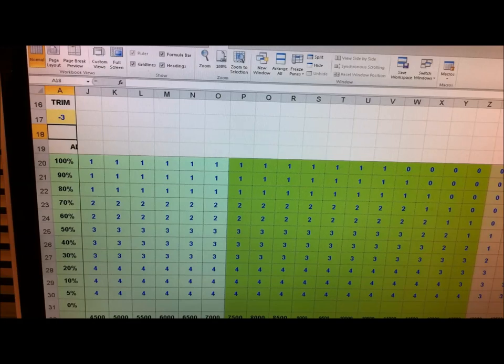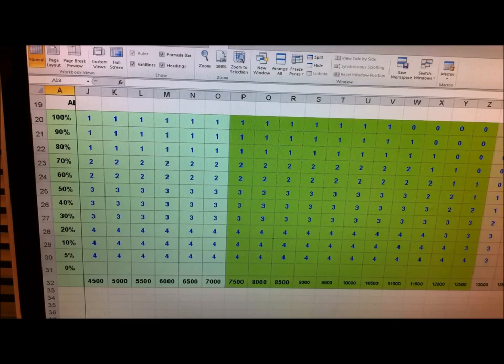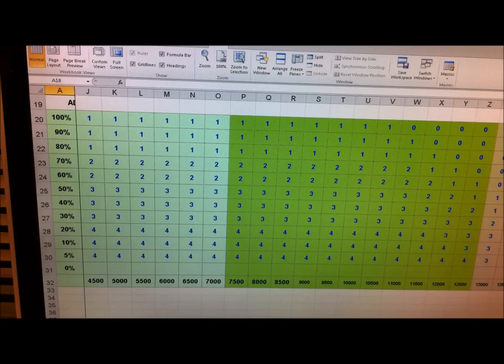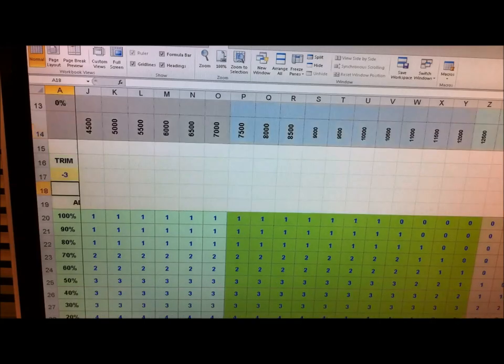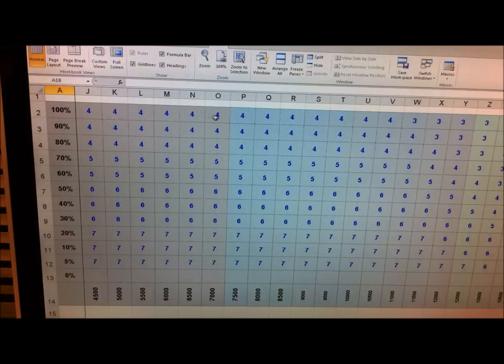I hope that explains how to set it up. You'll probably also notice that I'm only starting from about four and a half thousand RPM because I'll never really get below about six or seven thousand anyway on the track, and you're going up to about fifteen and a half, sixteen thousand on a 600. I've put a link in the description to RapidShare for this file so you can download it, and then set up your own base map depending on the corners and what sort of revs you're doing at the apex.